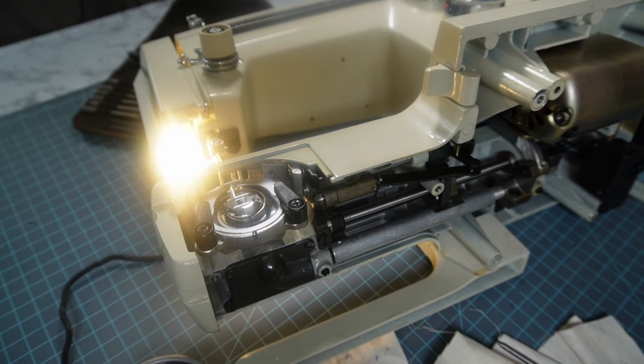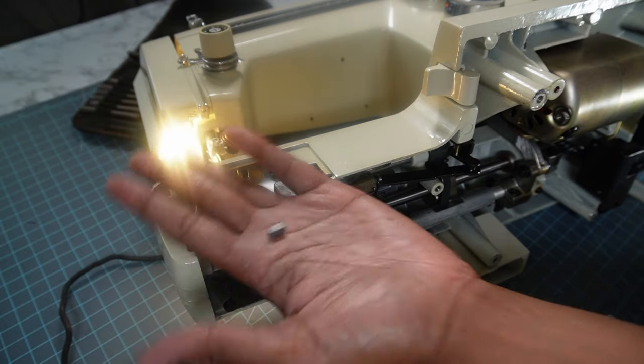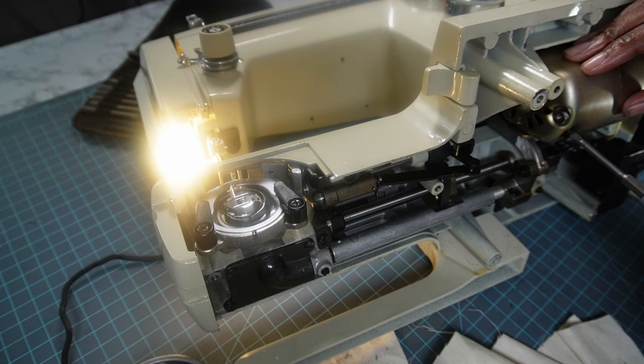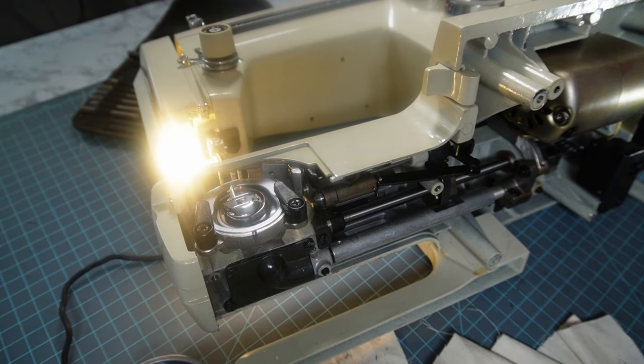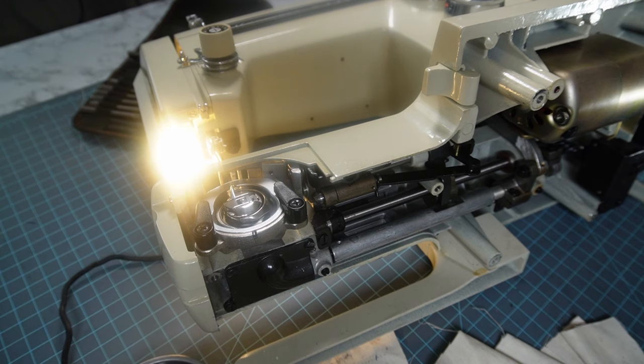Okay, so the only thing that I did was remove the broken motor brush — the other piece of broken motor brush is still down in there. I just put a brand new motor brush in and left the broken piece down in there, and that's really all that I did, and now look — it's working. So I suppose that was what the issue was, and now at least I know what the issue is and I can get back to sewing on my project.